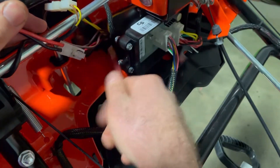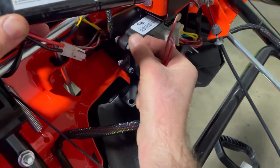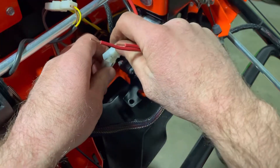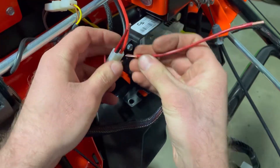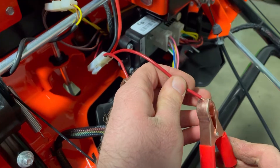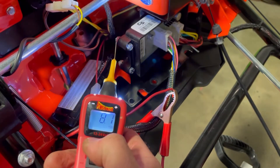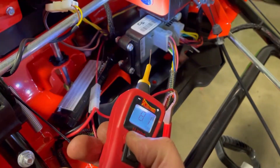I do have all of this loosened up already, so you can go ahead and do that. Our whole control system should be loose. The battery does help if you take it out. You can also test the battery by just unplugging it and testing the voltage right here directly. We're going to test this battery voltage — backfeed positive and negative. We got some power on our power probe, so we know there is some voltage in the battery. We hit our positive and we've got 8.1 volts, so we're good there. We've got plenty of voltage to run our system.